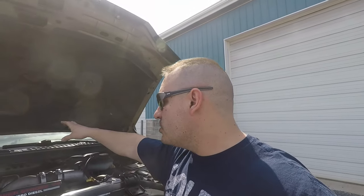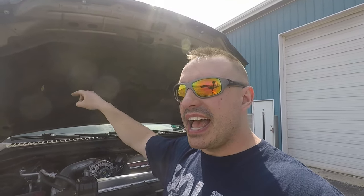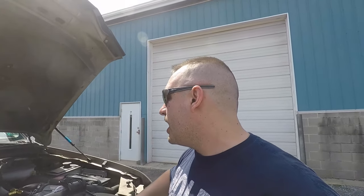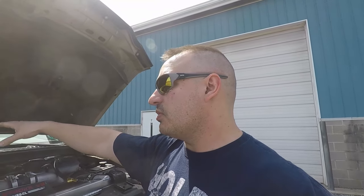Lastly, verify you don't have other issues — if you're not getting enough fuel, you're not going to see enough boost. I'll put a link below to a video on diagnosing why we went this avenue as opposed to other things that could be wrong, such as the FICM. Like I said, we replaced the exhaust back pressure sensor, got new heavy-duty boots and clamps, someone previously replaced the MAP sensor which I don't believe was needed. The intake isn't super dirty and isn't tripping the filter minder either. The truck's been really well gone over and I've double-checked the exhaust connections.